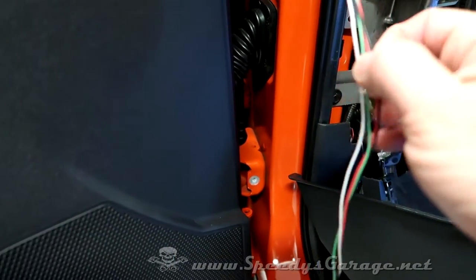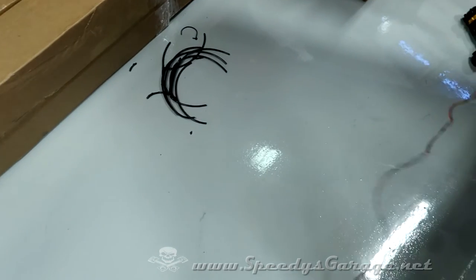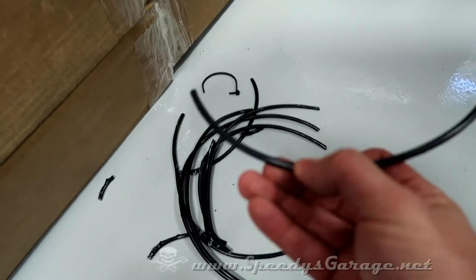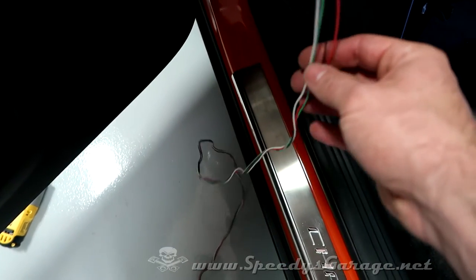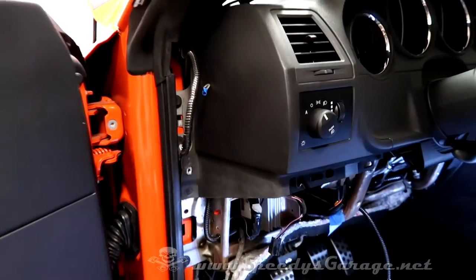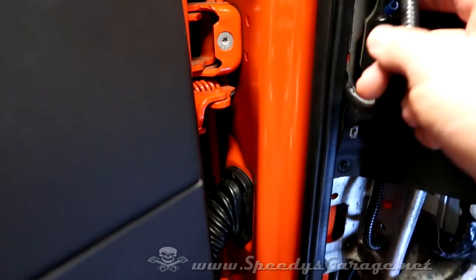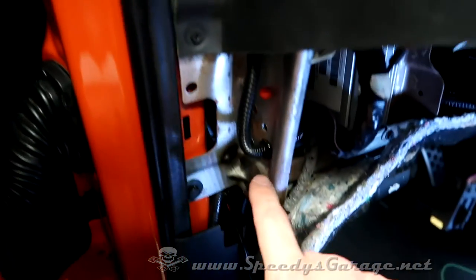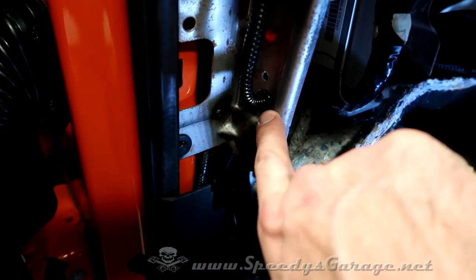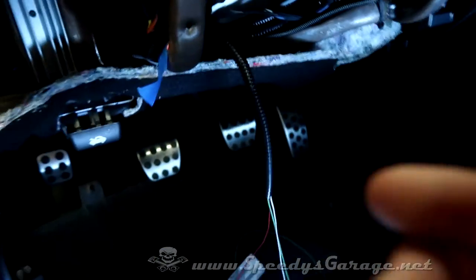I'm going to take the black wire and put a ring terminal on it and bolt it here for ground. Because the other wires run different places, I went ahead and removed all of the rubber sheathing — had to do it in small pieces — and I'll put my own back on to finish it off. I ended up using some of that corrugated wire loom. There's our ring terminal for ground. I ran the rest of the wire harness down behind the panel, through a hole in the dash brace where I put a rubber grommet, and ran the wires in the loom back to where all my custom wiring terminates. I always zip tie it to that brace.